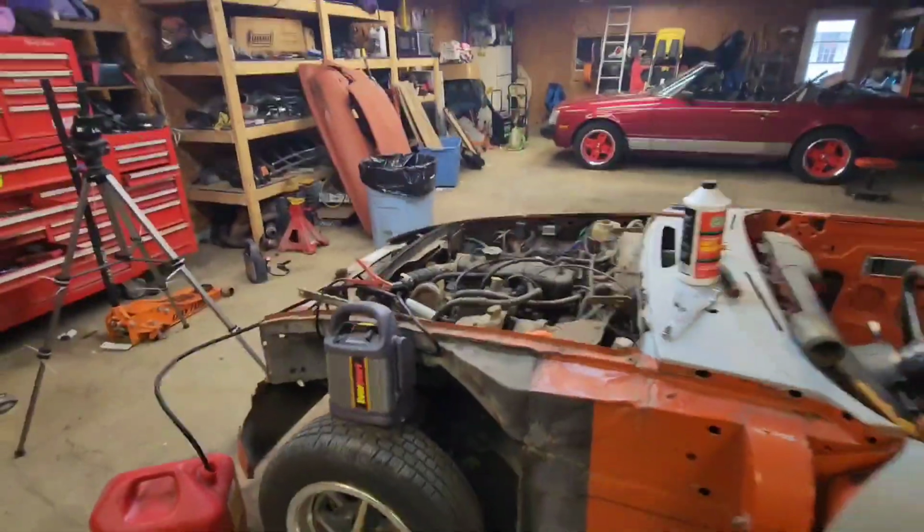There we go. I can't call that running flawlessly at the moment, but it runs. That's a start. So now I don't feel nearly as scared to order some things. Although I do not think the firing order is necessarily correct at the moment. Maybe I put the cap on backwards. Not sure, I'm going to double check that. The points also are nowhere near adjusted like any kind of proper. They just work, and I chucked the cap on.